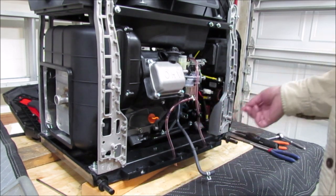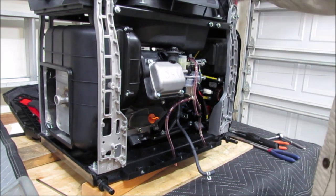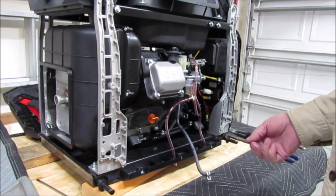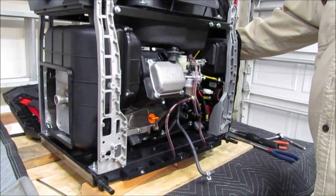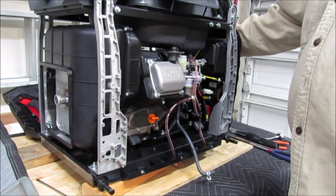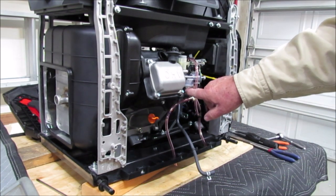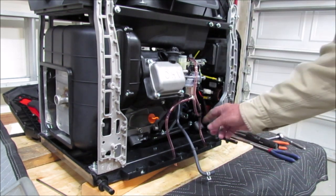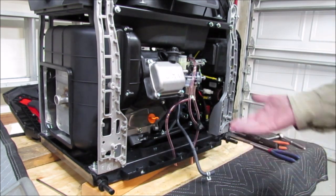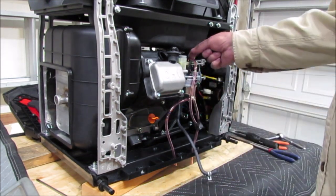Interestingly, when you open this screw with the switch in the off position and the front panel off, it will drain the bowl for storage. But if you put the switch in either run or start — which is full choke — this front panel switch is actually a fuel switch too. When you open that screw, it will not only drain the bowl, it will drain the tank. Good to know, if you can actually get one of these generators to work.